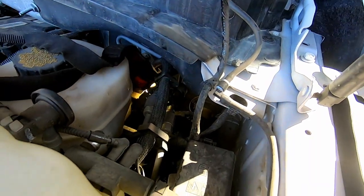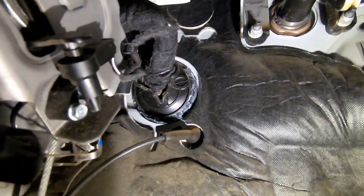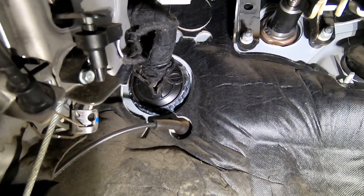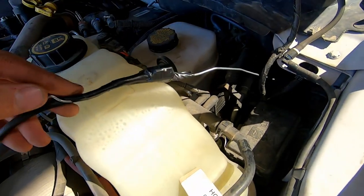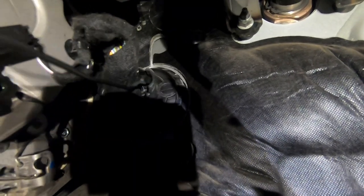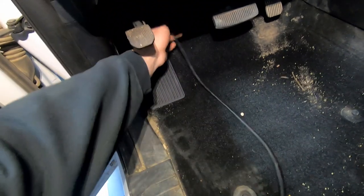Go in the cab and do the same thing on the other side. Then use a piece of metal like a coat hanger, push it through, tape the connector to it, and pull it into the cab. Here's what it looks like from inside the cab — you'll just have to figure out a way to cut enough of that rubber to get the connector through. I've got an unwound coat hanger pushed through the hole, taped to the blue sensor, and I'm just pulling it through.